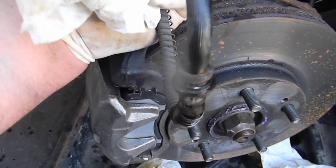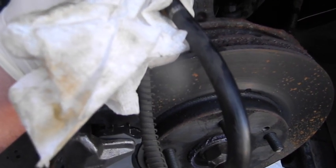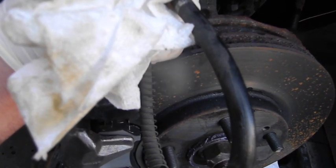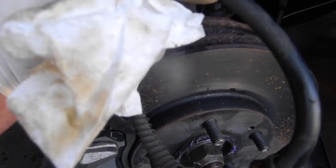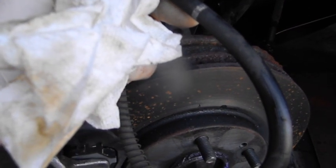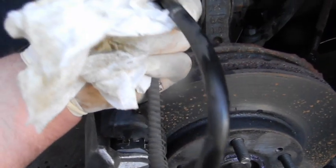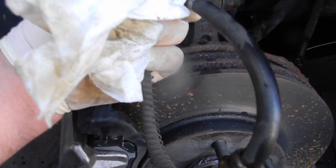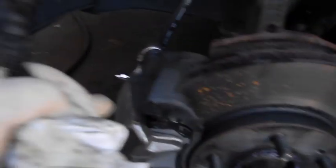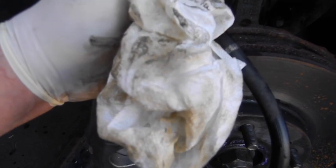The coupler has corroded and crushed the hose. Bear in mind it's a very tiny hole in that hose — like brazing wire. It doesn't take much, because this hose is rated to handle 1500 to 2500 PSI, but it doesn't take much of a swelling to cause a problem. The other caliper went right in so we're good, but I should invest in a second hose. This car did not drip bleed when I put the caliper on, but that's not uncommon because the assembly loop keeps it from drip bleeding.